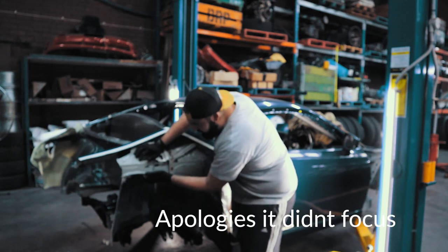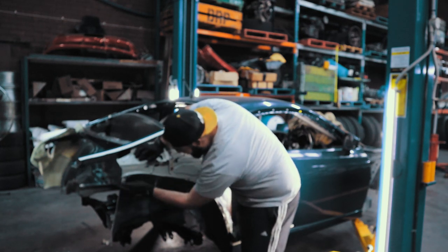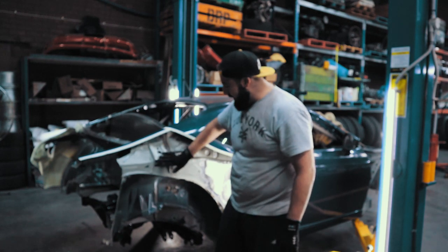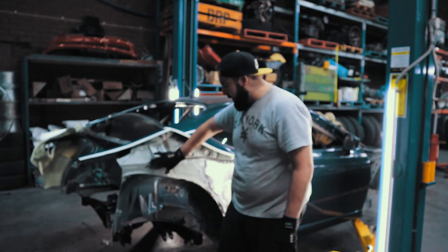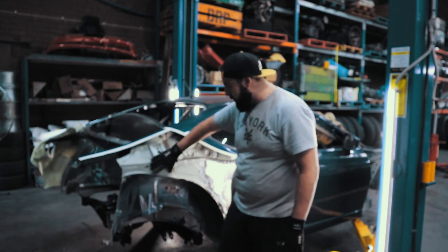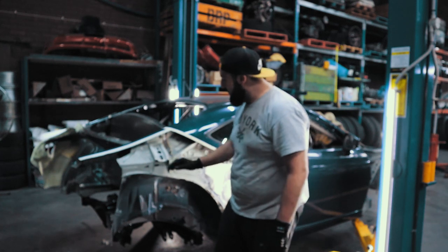and I'll throw a few spot welds under there just to hold it back in. I mean, it's not going to go anywhere, but just to tie the panel back in. And then I'll just clean these up as well. Might finish them flat and put a plate there just to seal it up. Because it looks like there was a structural bracing along here, but mainly just for the strut towers, I think.